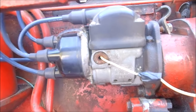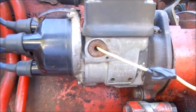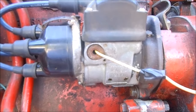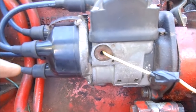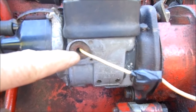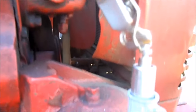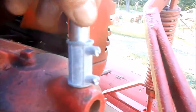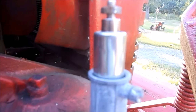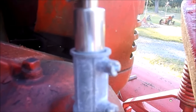The wire was just screwed up in there, couldn't get it to feel safe and secure. So, thinking outside the magneto, I took the condenser out completely, connected the coil wire and the points wire together, sealed them up tight, and left them inside where the condenser normally sits. Then coming out of the hole here — where the cutoff usually goes for the condenser — I mounted the condenser right there using a piece of electrical conduit onto a bolt for a ground. This was my crude test.